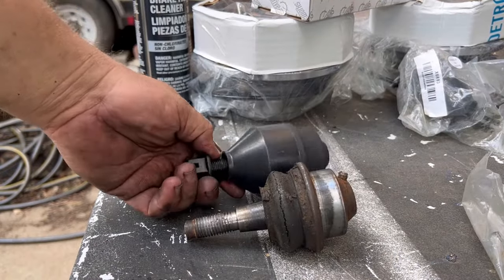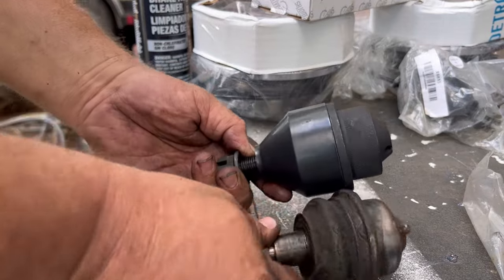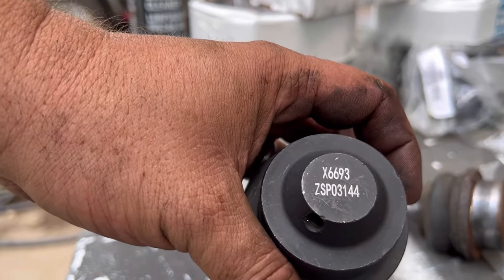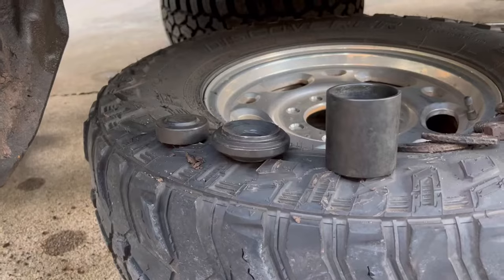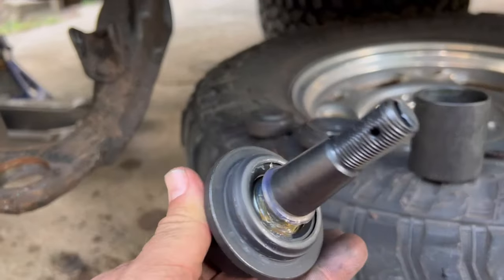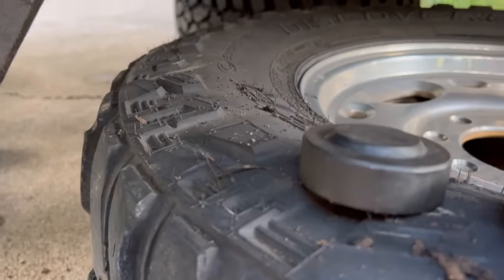Here is our new one. We want to put them up side by side and make sure they compare as far as shoulder height. This, by the way, is a product from Detroit Axle — that is an X66-93, and you'll get two of these in the rebuild kit. To press in our new ball joint, we need a collar or sleeve that fits the shoulder of our new ball joint. I've removed the dust cover, and you're going to need a bottom cap to press from the bottom and a top cap to press from the top.